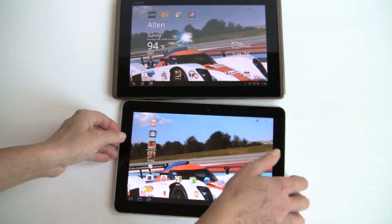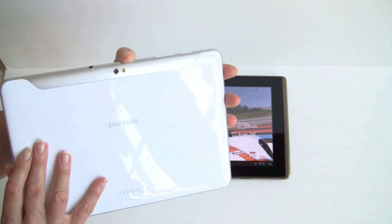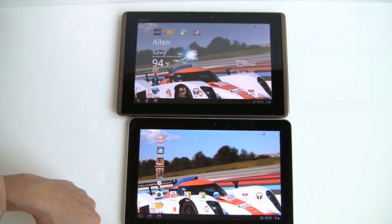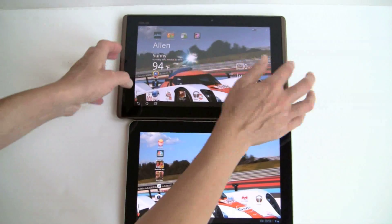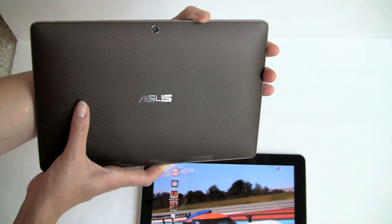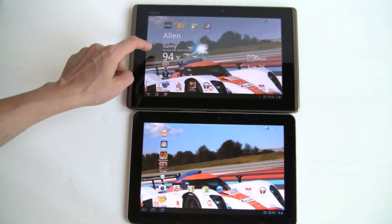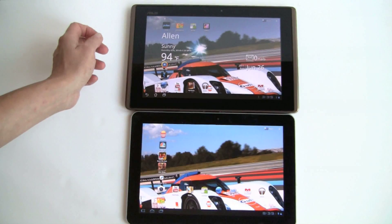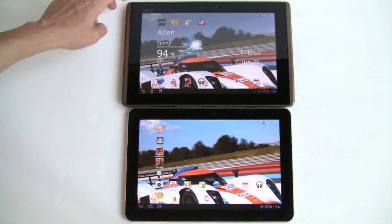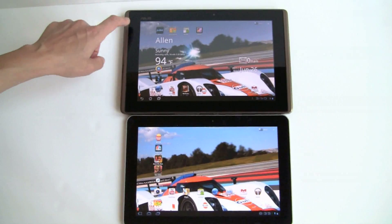In terms of cameras, the Samsung has a rear camera with an LED flash, but it's only 3 megapixels — we're kind of surprised at that. On the front it has a 2 megapixel camera for video chat, which works with Google Talk video chat. The Transformer has the same front-facing camera, roughly centered, and also works well with Google video chat. On the back it has a 5 megapixel autofocus camera, but no flash. Both photos and 720p video — the Asus wins for quality and exposure; the Samsung tends to white out more. When the Transformer first came out the camera was a little flaky, but firmware updates have really addressed that and we're quite pleased with it now.